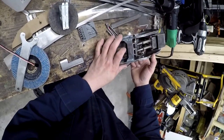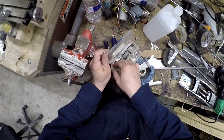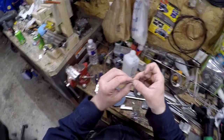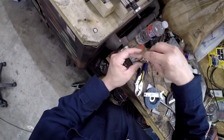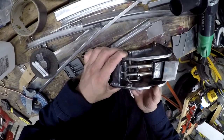It works, but it doesn't quite hold it all the way up — it could use a little more pressure. So let's get a little spacer on that spring. I'll use one of these shock spacers — put the flat side down so it can still grab the spring, rounded side up so that goes to the bracket. All right, it's all the way up now.